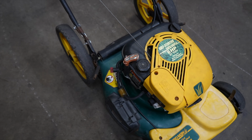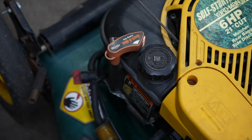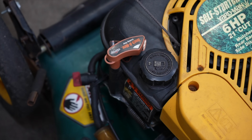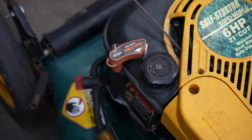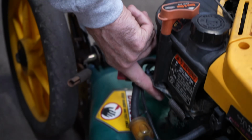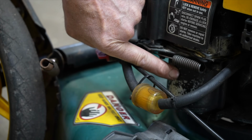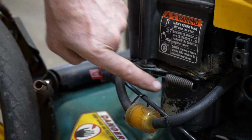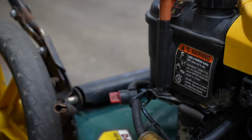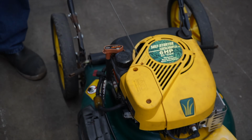Hear that grinding, clackling noise? That's the engine rewinding this powered spring starter on there, which is underneath the tank, which is back here. This thing right here that looks like an electric starter. This is the same engine block that would use a 12-volt electric starter. But some genius over there at Briggs and Scrap 'em came up with this idea, this Touch-N-Mow.